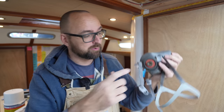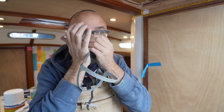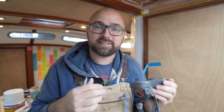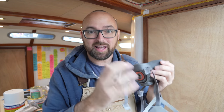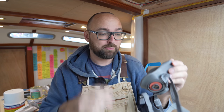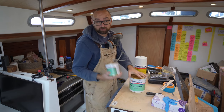I am sure there's somebody in the comment section that's going to point out that, according to OSHA or whomever, you can't get a 100% seal with one of these masks when you have a beard. And that may technically be true, but I can tell you from personal experience that this thing does make a heck of a difference. As a little experiment, I've removed the filters and I'm covering those filter mounting holes with my hands and sucking. I can feel a tiny bit of air coming in through the beard, but that's with 100% resistance. Wearing the thing has to be better than not wearing the thing. Enough safety yammering — let's get some primer applied.